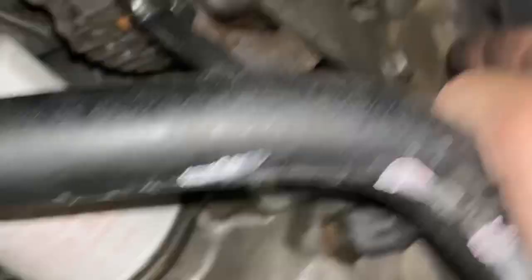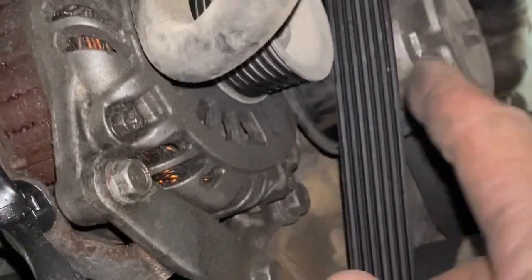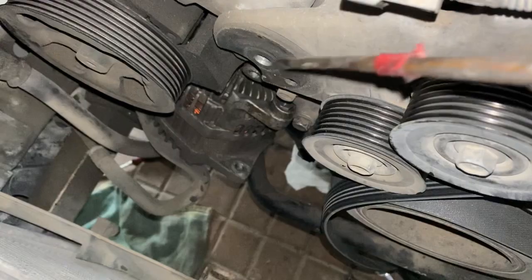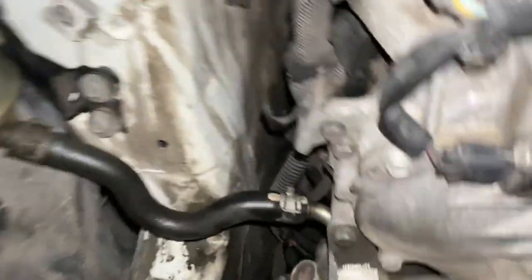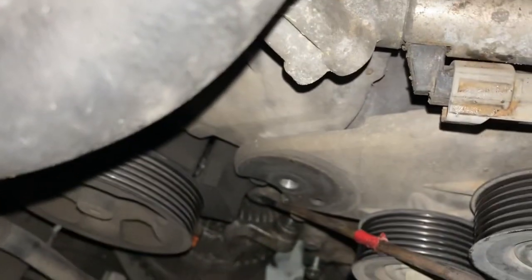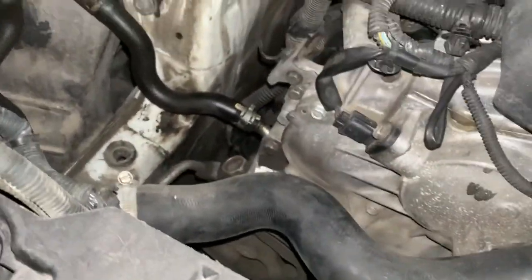The alternator uses 12-millimeter bolts — there are one, two, three of them. I'd recommend wearing gloves as it gets quite dirty, especially if your car has an oil leak, which this one does. In the end we did have to remove the tensioner bracket, which was a 14-millimeter bolt, and behind it in a small groove is another 14-millimeter bolt — the top bolt of the alternator. So there are actually only two bolts holding it on.